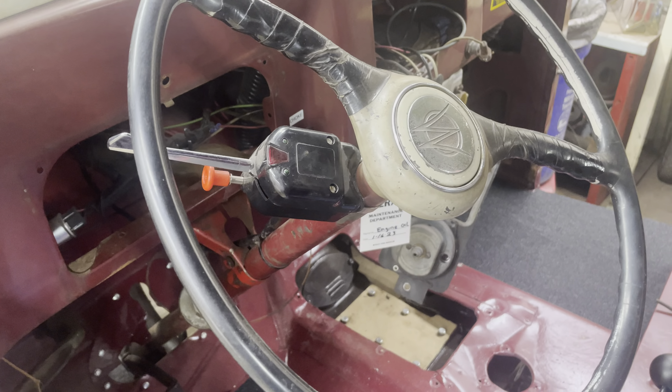I'm going to leave that square opening that was for the voltage and fuel gauges. I have round replacement ones in the box, but they don't make square ones anymore - the used ones are like $300 and probably won't work. The standard diameter is two inches and I need inch-and-a-half to fit side by side in that square space. My idea is to someday get an HD reverse camera and mount a small LCD screen - maybe a two-by-two - right in that space.